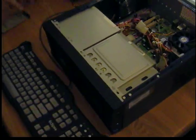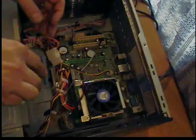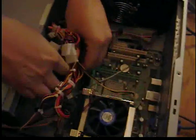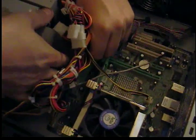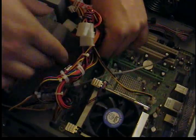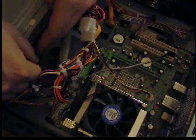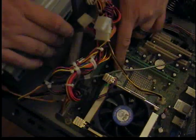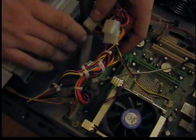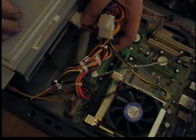The installation part is done. Now you want to put your cable on — hook your cable onto the 40-pin connector. If you bend these pins you can straighten them, but they're very hard to plug up once bent. Plug this in the back; it has a notch in the drive as well as the motherboard, and these cables will only plug up one way, so if you have to force it, it's not going in right. Then plug your power connector up.